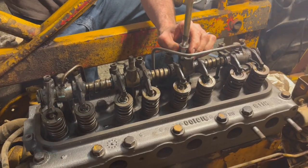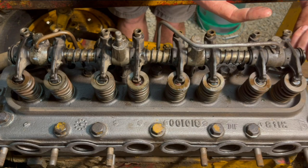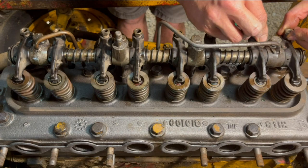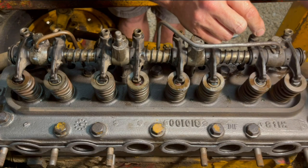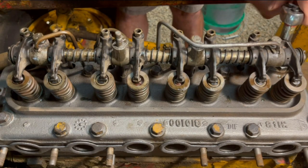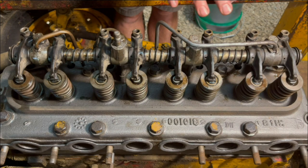So we're just going to snug these down and then go to 25 pounds and then 50 pounds. For each cylinder with the piston in the top dead center position of the compression stroke, both of these should be just a little bit loose. You have them set correctly when a 15 thousandths feeler gauge is kind of snug. This one is about right and this one is obviously very loose. So we tighten this up to close the gap — much better. Repeat for all four, and the book says to actually do it again when the engine is warmed up and running at idle speed.